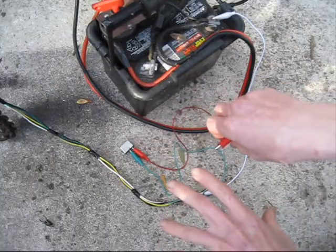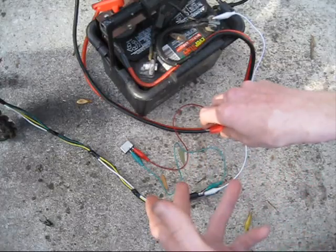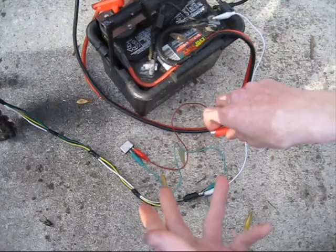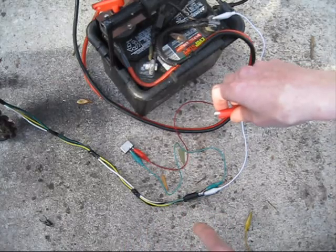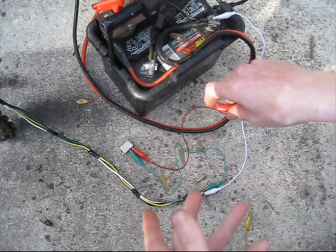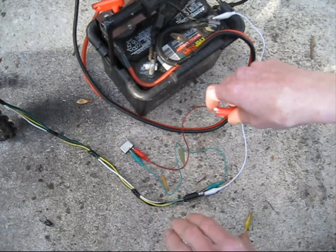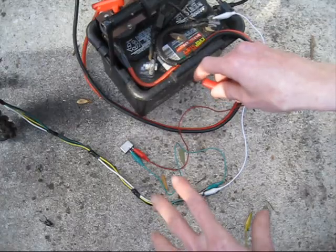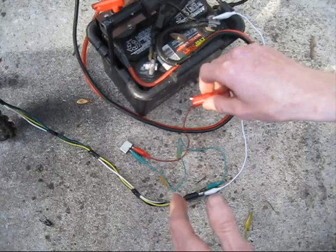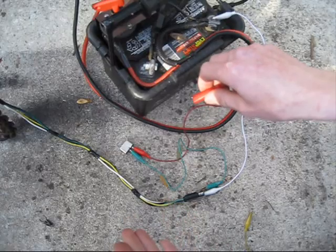The reason I have this circuit breaker is to provide overload protection. If your trailer wiring is in really good shape or is new and everything is working properly, you can probably get away without it. But if your trailer wiring is questionable or the trailer has been blowing fuses on your tow vehicle, you definitely want some kind of overload protection on your positive feed. It doesn't have to be a circuit breaker — a regular fuse works too. I just like circuit breakers because if they trip, they reset themselves and you can keep using it without needing a replacement fuse.